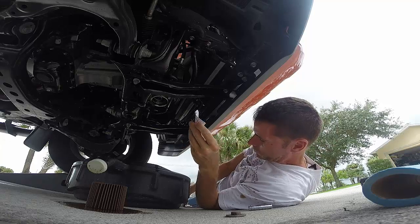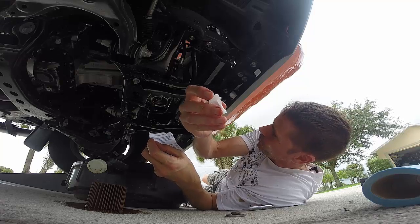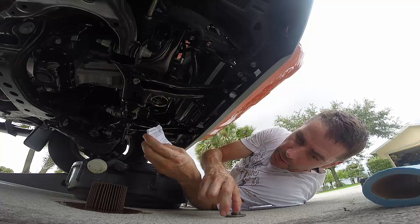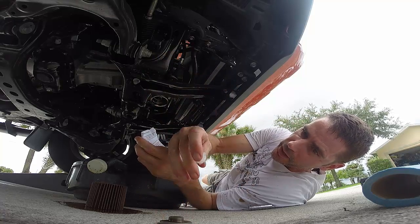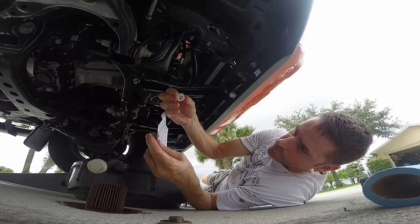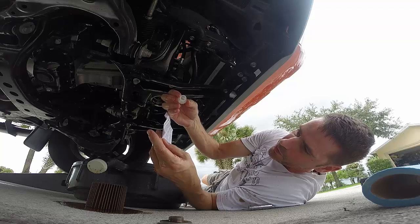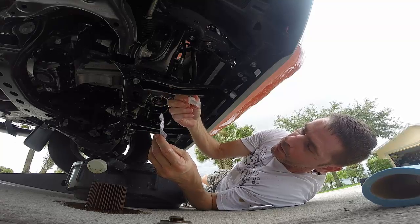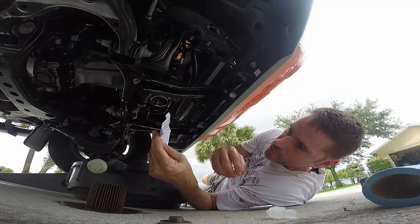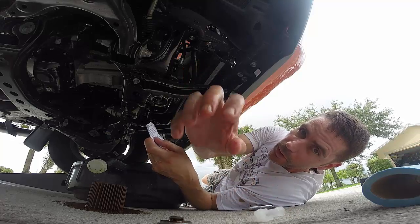That's interesting. When I open this up, it says that you remove that metal piece, and then you insert this into the spot where the plug was, and then this is supposed to drain the oil, I guess. So my bad for not realizing that. Install drain pipe into cap by turning clockwise until snug and drain oil. And it says if you want to go crazy, you can put a hose in the end to further route it down. So that's interesting. So keep that in mind next time. If you get one of these in your oil filter, use it to drain the old oil.